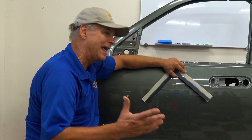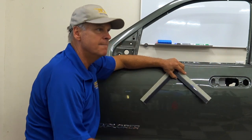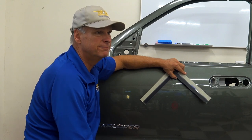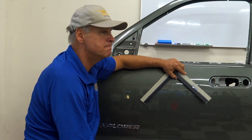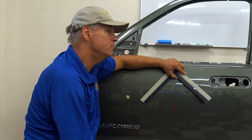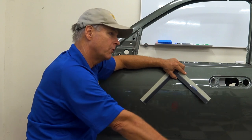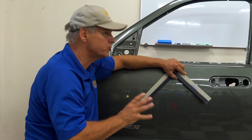I'm telling everybody, man, anybody can move metal. You can take this, put it behind something, any idiot can move metal. It's moving it in a way that gets you to the fast finish that counts. The nicest finish, yeah. Absolutely. Tension will always do that. You hold the tension all the way until the dent is finished, to at least about a 90% repair level, probably even a little bit further. I get all my pressure traps out. If I have to re-arc the panel, everything, that's all done while there's tension on it.